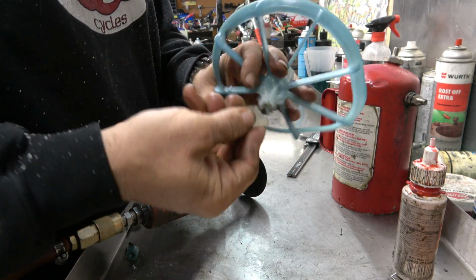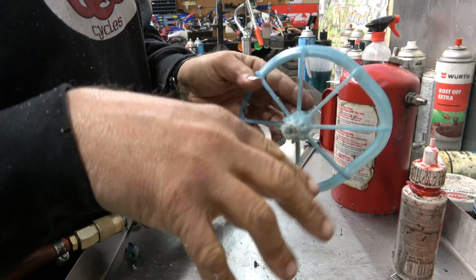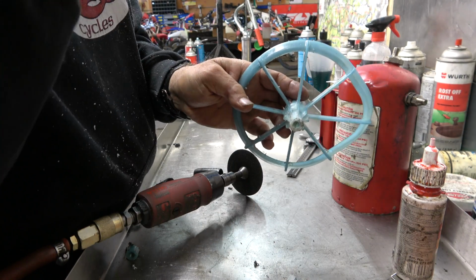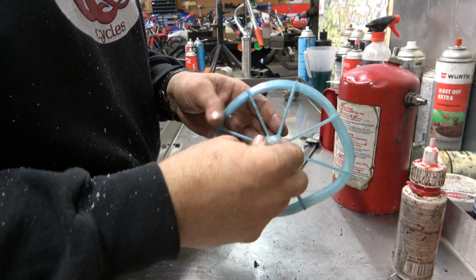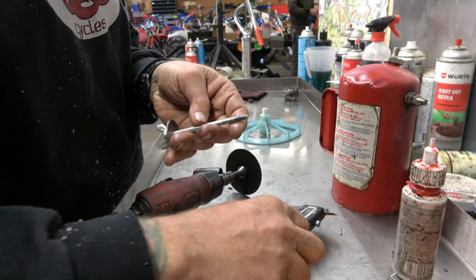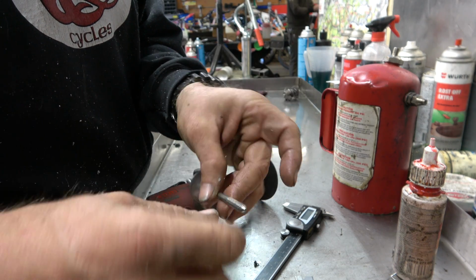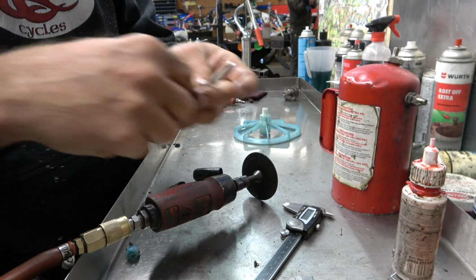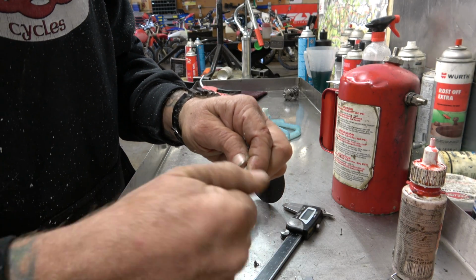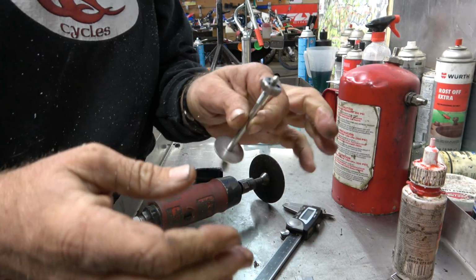Clean that hole up a little bit. And obviously I'll get this super duper cleaned up so this plastic doesn't go through the motor, but right now it's got to take 10mm off the screw. And then we're going to have to re-thread it. So actually, before I do this, I'm going to see what size this is so I can get the right die out so we can re-thread it further down. I think it might be a 6x1. Alright, it is.